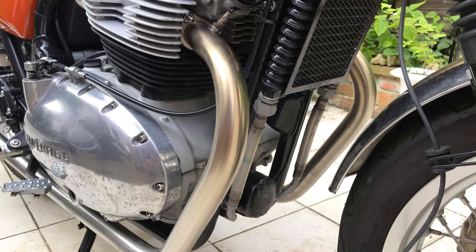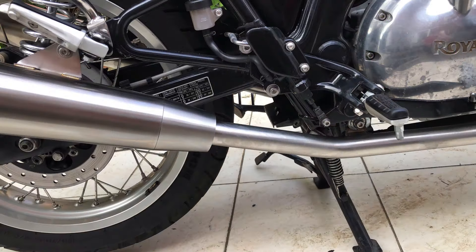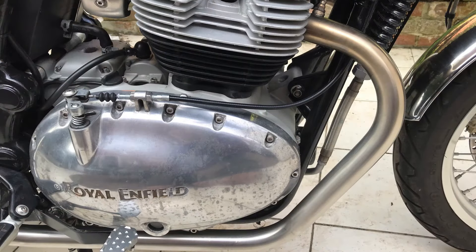It's just a case of putting everything on loosely, getting the can on its bracket loosely, and then tightening up the clamp on the head evenly either side. I'm absolutely delighted with these — the finish is fantastic. The Stratus headers are straight through with no horrible welds inside like the stock ones I covered in my previous video. The AEW cans you can't fault them — the production quality is really, really good. The hanging bracket lines up, everything just slots straight on. Probably 20 minutes if you fancy timing yourself — I took about half an hour for the two.